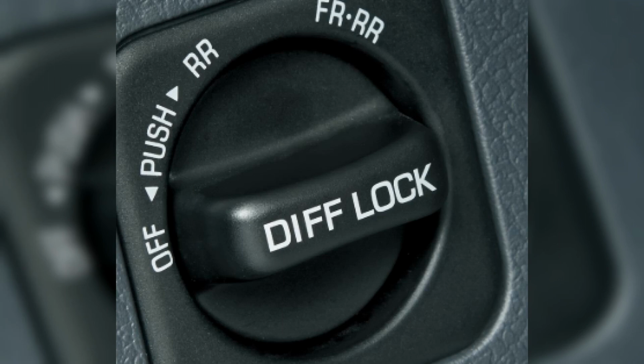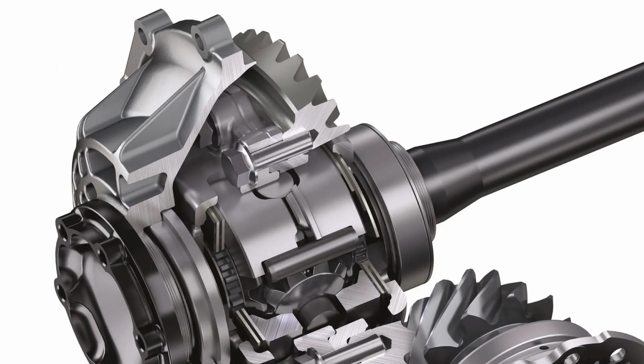How to make one? It is easiest to make a permanent full differential lock. But such a homemade lock is acceptable for cars traveling only off-road, for example, for rally raid cars. To realize the idea, you need to remove the unit equipped with a differential and disassemble it. After that, weld the satellites to the axles. Fixing the gears will allow the mechanism to share the speed of rotation between the axles only in the proportion of 50-50.